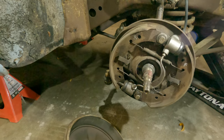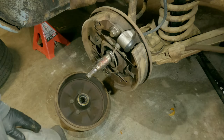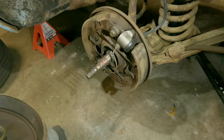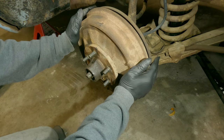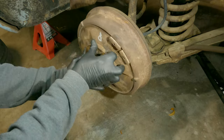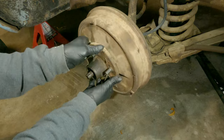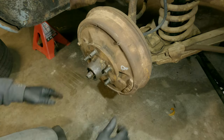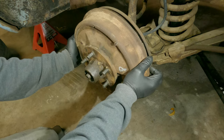I'll put it on and we'll spin it. Everything looks good in there still from when I greased it before. She's a little snuggly. I could take it out a little bit, I guess. It could get adjusted a little - there's no question. It pulls to the left. When I step on the brake, she pulls to the left. And then this one catches. So let's take her out a little bit. I don't think I'll need to fool with the other side, but we'll look at it.